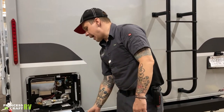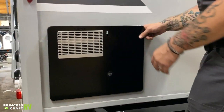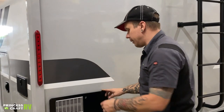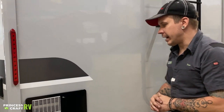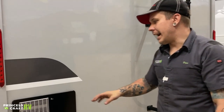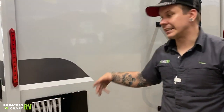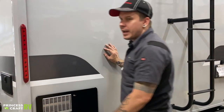The only other recommendation for the water heater is the addition of a bug screening material — go ahead and cover these vents to keep any mud daubers or flying insects from nesting in the appliance. This is a big problem here in Texas. Flying insects are attracted to the smell of propane and will crawl deep within the appliance to make their nest. It is very expensive to have those nests cleaned out once they've nested in there.